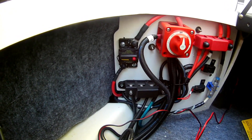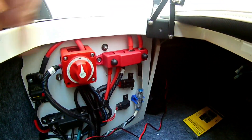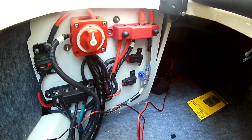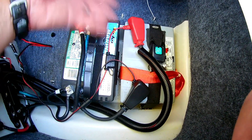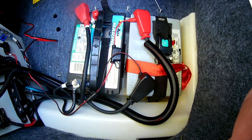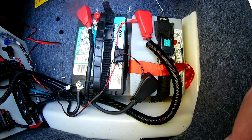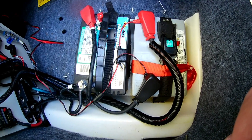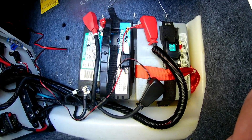I'm sure others could do a better job, but for now it's what I've got. I'm going to mount the NOCO charger right back here. In the future I'll probably swap the gel cell out for another marine battery and use one battery per outing, letting the boat charge it, keeping the NOCO as a backup. I also like having it to hook to the batteries over the winter — I hooked it up to each battery a few times over winter just to top them off and keep them maintained.